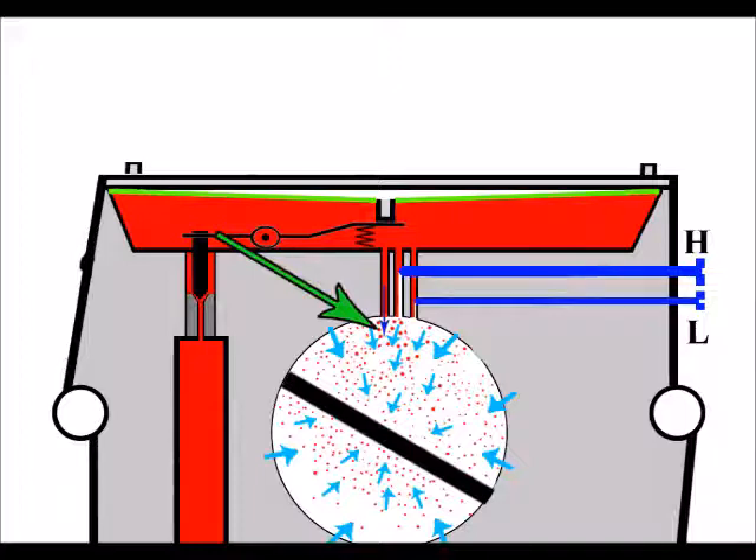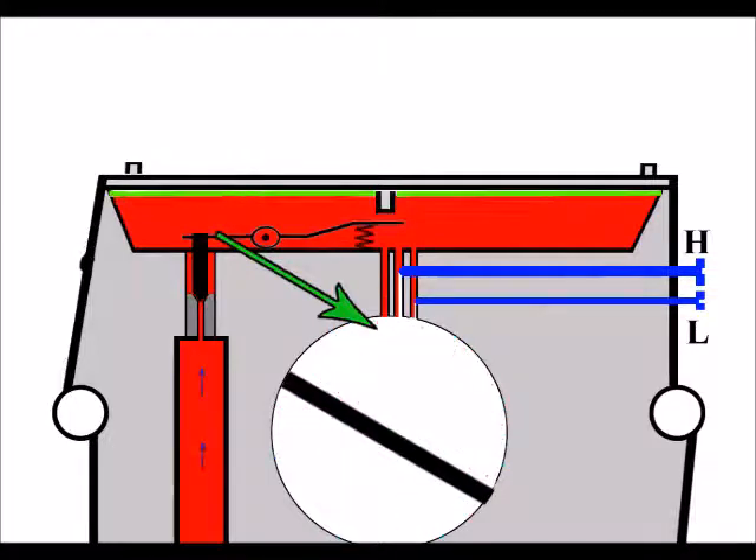I've used air and fuel in the center of the carb just to illustrate the next point. In this scenario there wouldn't be that much fuel available — if the engine ran at all there might be enough for idling speed, but if you pull the trigger and open up the throttle there'll be less and less fuel available, and then as the engine demands more fuel, bog down.